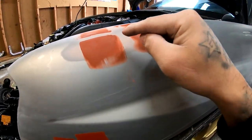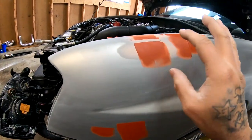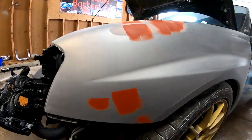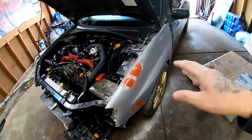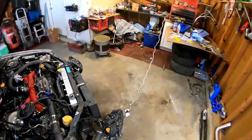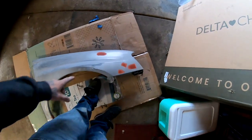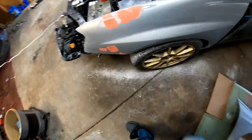You can see it's already starting to flash off in some areas — it's changing color. But this compound is really soft so you'll be able to sand anything that was put on too thick. I'm going to go ahead and do the other side because it all has to be sanded. I'm ready to call it a day. I went ahead and took off the fender and it's over here now just drying. I went ahead and put some glazing compound wherever I thought I needed it, and this fender has been drying for about the past hour.